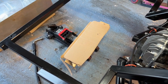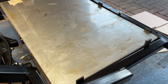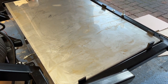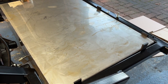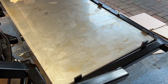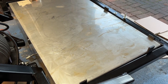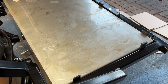Prepare your trolley jack with some protective cardboard so you can put your fuel tank on there and raise it up into position. I've used some plastic spacers to make sure it's absolutely central and square. Now I'm going underneath to mark out where the new holes are going to be in each of the tabs, then lower it out, drill those extra holes, raise the tank back up, and use a sprung center punch — so nothing moves too much, no hammering involved — to mark the position of the ten holes I need to drill.